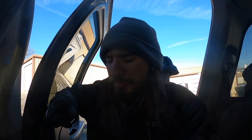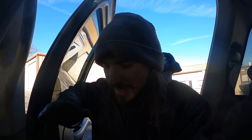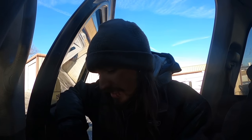So I'm just trying to get the truck warmed up right now so that I can see if there's any air pockets in it once the thermostat opens, you know, all that stuff. I think the leak's fixed. I need to find a better spot to put the accelerator cable as opposed to putting it on that fuel fitting. So hopefully it doesn't leak anymore. I haven't seen it drip. I've been watching it for about 5 minutes now. Haven't seen a single drip. So fingers crossed.